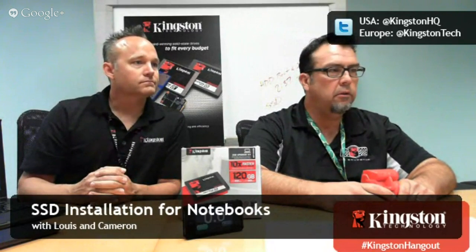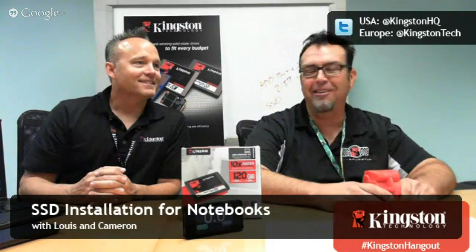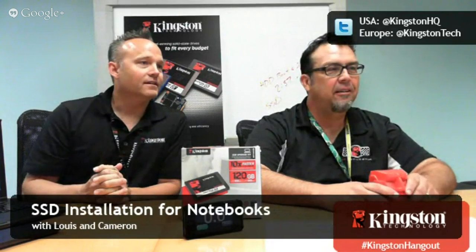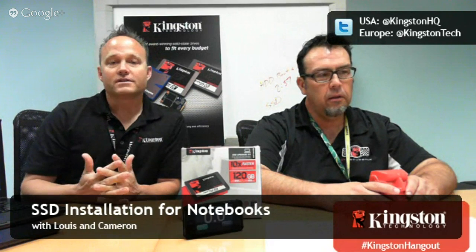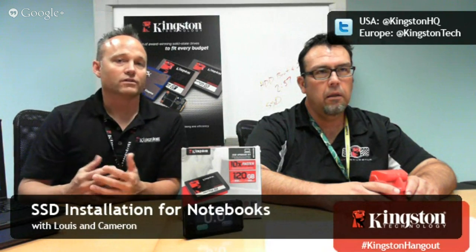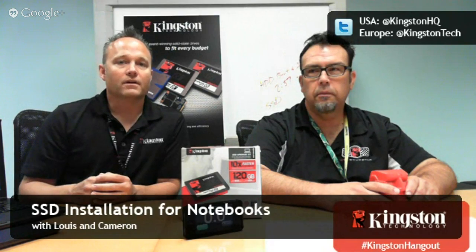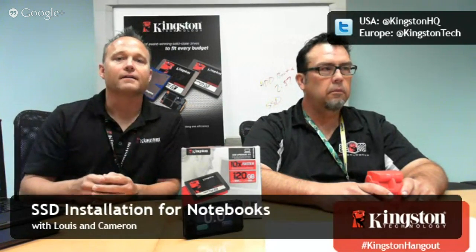Cool. Okay. Still more coming in. This is right up your alley. Cameron's kind of our RAID specialist. So, are SSDs good with RAID? Are there any RAID configurations that are not supported in an enterprise environment? We always say you can use an SSD just like you use a hard drive, and that does apply to the world of RAID and RAID controllers. RAID controllers are great for adding performance to your storage, and redundancy. With an SSD, if we're getting 500 megabytes a second out of a single drive, and we put that drive into a RAID 0 stripe with two drives, you can expect to get twice that performance, which would be 1,000 megabytes a second.